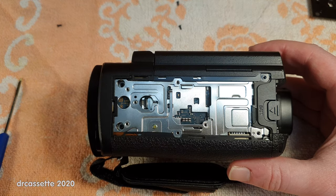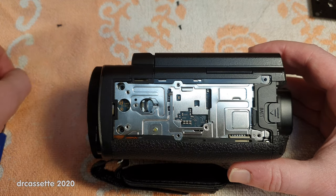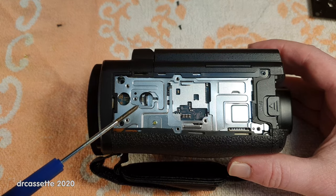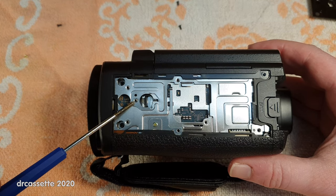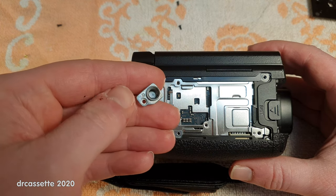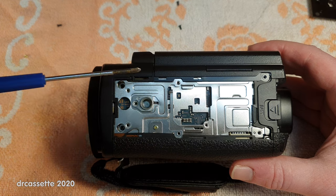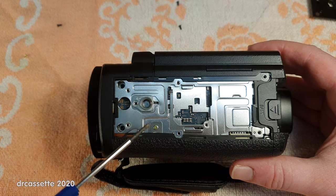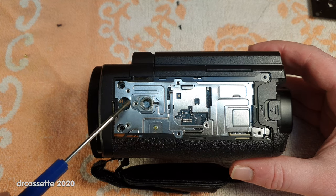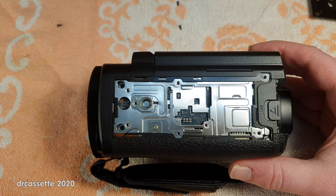It's really sad and really frustrating. This is a real design flaw, and it's so easy to fix. We have this chassis all around, so it would be easy to drill and tap more holes — right there, and right there, and right there — and extend the material around this tripod mount to be able to mount it in four points all around. The way it's mounted now is only at one point, and that is not enough at all. It's quite surprising that Sony didn't notice that was going to be insufficient.